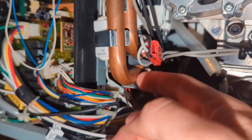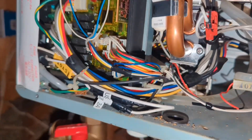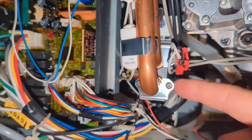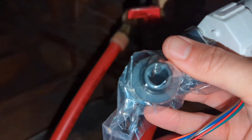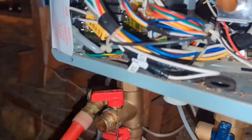Continue for the full walkthrough. Once you've got the panel off, you want to locate the mixing valve, which is right behind here. When you look at the new one, you can see it has four Phillips screws. You should be able to undo those plates and pull the copper clips back a little bit. On the other side it looks like it's some kind of clip with an O-ring, and if you look inside you can confirm that's what it is.